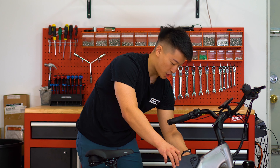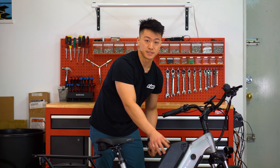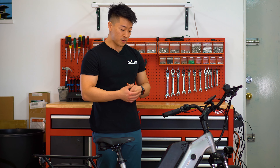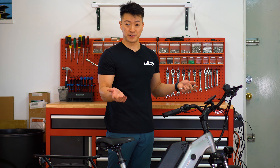You're going to want to lock your secondary battery in place. Clockwise is the motion to lock it, and you want to make sure it's fully locked so while you're riding it doesn't detach when going over a bump or anything else that could cause the secondary battery to fly off.